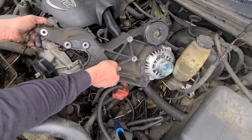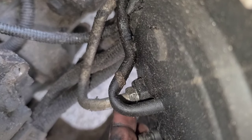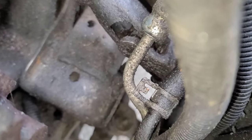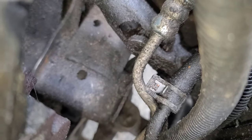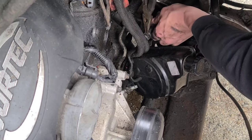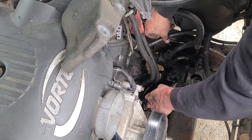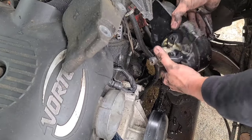We should be able to move this right out of the way. Looking at the back of our power steering pump, we have one line right here — that's a 16 millimeter — we're going to go ahead and remove that. If you follow the other line, it has a clamp; just squeeze that, pull it back, and we'll be able to remove that line and take this pump right out. Then we can pull this line off and get the old pump out of there.